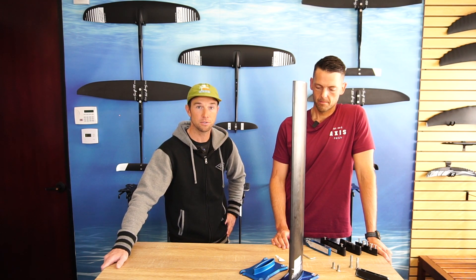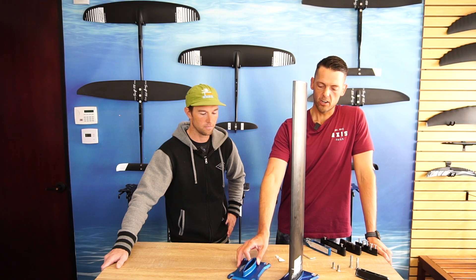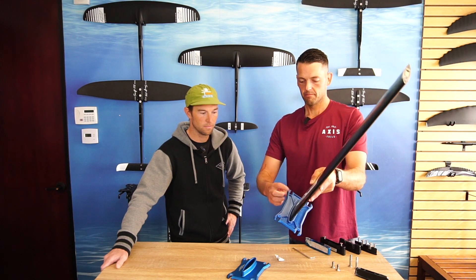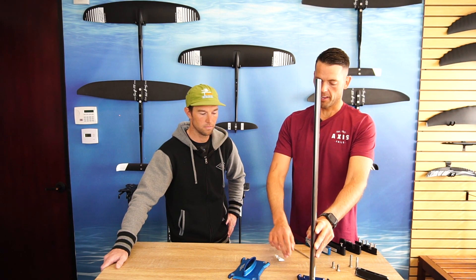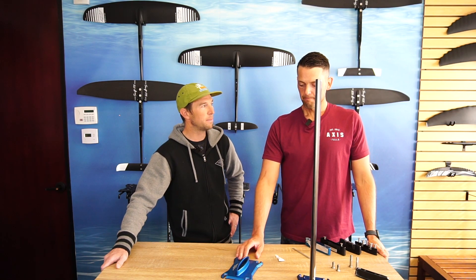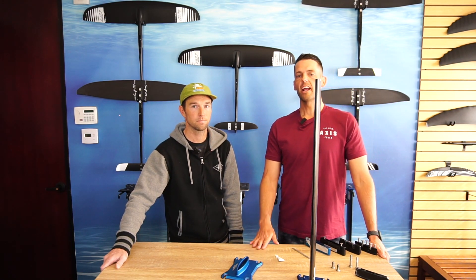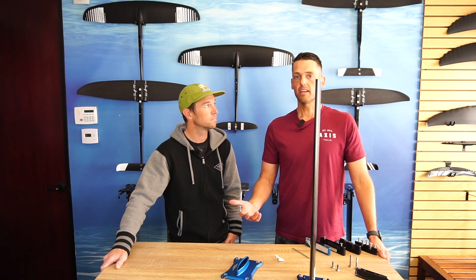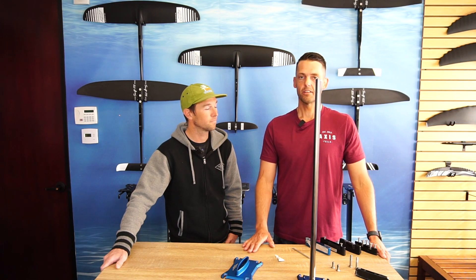You can pick and choose which one you prefer. Mine is about 30% thicker on the actual plate itself. This one you can see is cut out and skeletonized, while mine is the full solid and it's thicker on the thickest part, and the collar is thicker as well. It adds weight, but if you're doing airs, really cranking on turns, or if you're a bigger rider — I'm 200 pounds — it makes a difference having the heavy duty plate versus the smaller one.